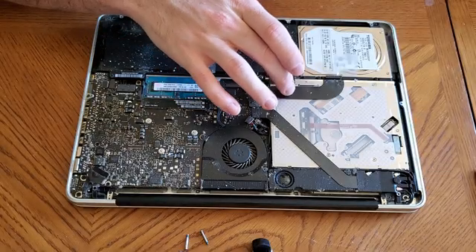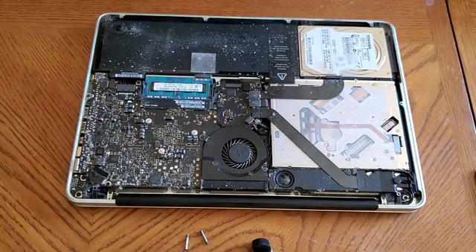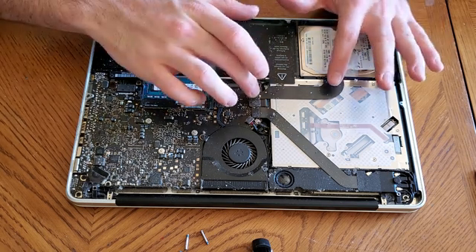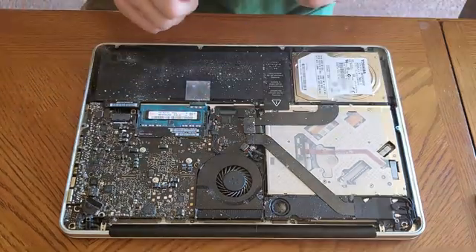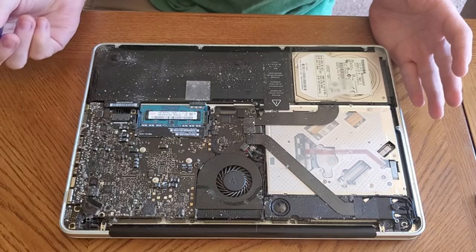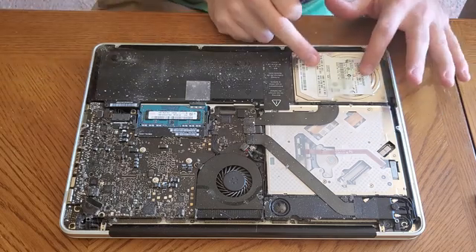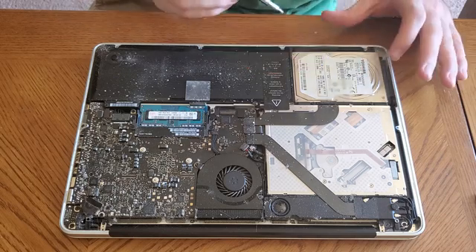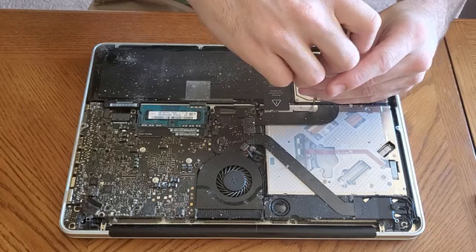Today I'm going to be working on this cable. So this is a hard disk drive. This computer is having an issue with a flashing folder icon, and this is how we're going to fix it. This cable is usually what goes wrong. I still need to blow it all out and clean it, but in the meantime I'm going to get this off because I want to connect this hard drive to my other PC to recover the data from it and make sure that this cable is actually the problem.